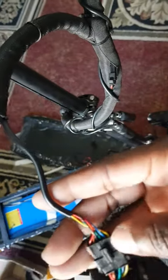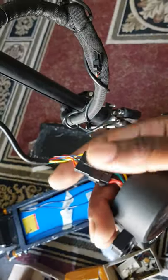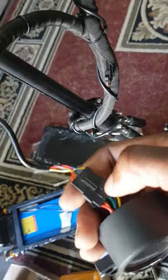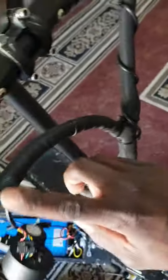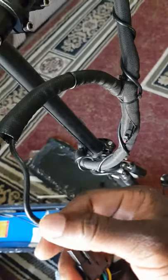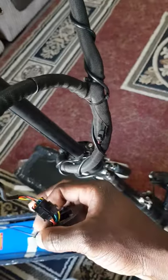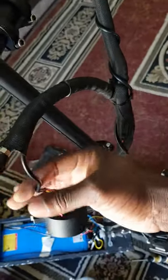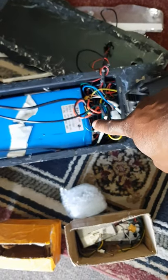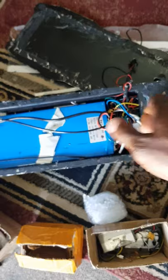One side of the cable from here is connected to this throttle unit. Once you unclip this, you can remove the whole unit and put it down. Then with the new one, you just unclip the other side and clip this side back in — and you should get your scooter going. That's if there's no damage on the actual cable. If after replacing the new throttle unit you're still having the same problem, it might be worth replacing the whole cable. Then you'd have to pull the new throttle set cable back into the unit and remove the whole cable by going under the deck to your controller — it's a five-pin connector with colors.